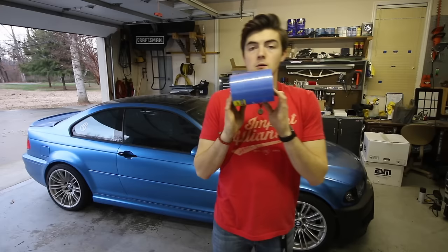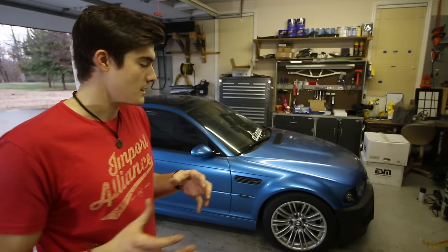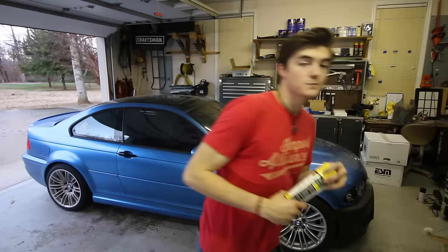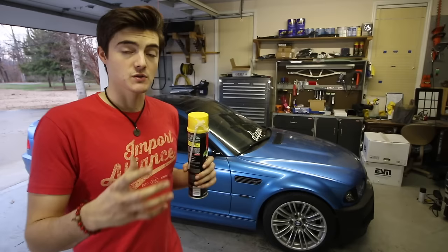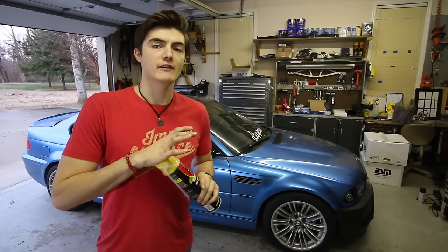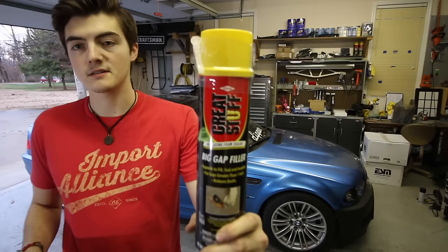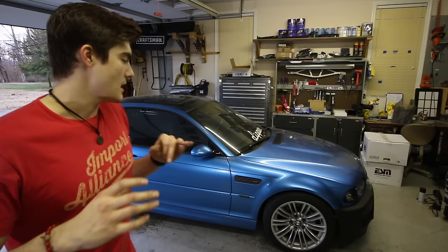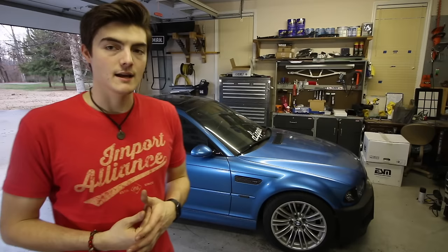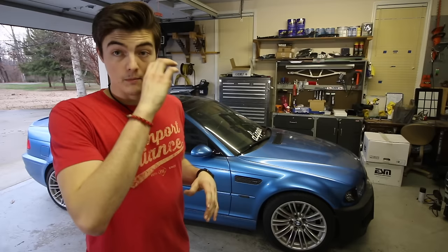What I'm going to do to create that: first I'm going to mask off each fender with blue painter's tape. Next I'm going to take cardboard pieces and go underneath the wheel well where the wheels are going to be mounted for the wide body. I'll take cardboard that goes out from there, then take expanding spray foam and fill the entire fender with it. Once it expands and hardens I'll start shaping. I've also got some other foam I bought a while back that I saw another guy on YouTube using, which I thought was pretty cool. You can actually get this stuff at Lowe's. My big project today is just filling everything with foam, and once it dries I'll start shaping.